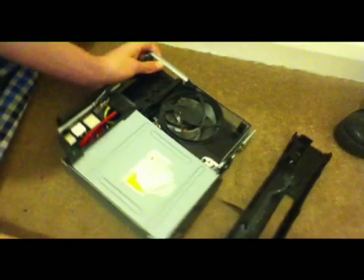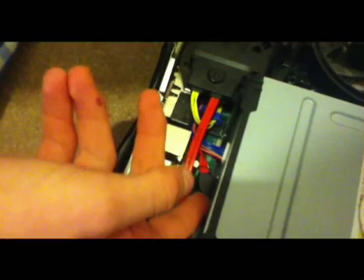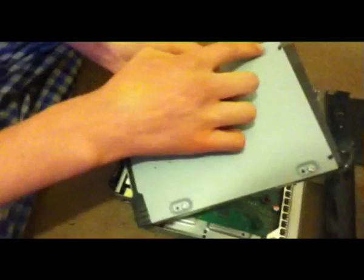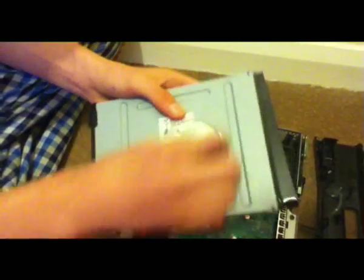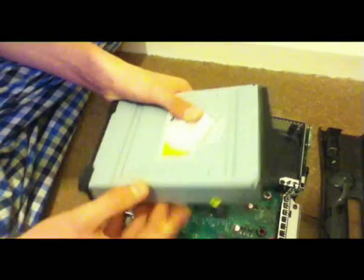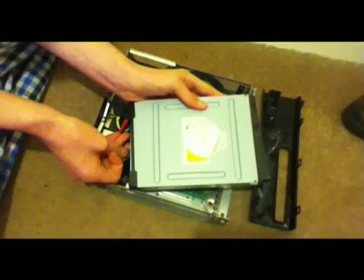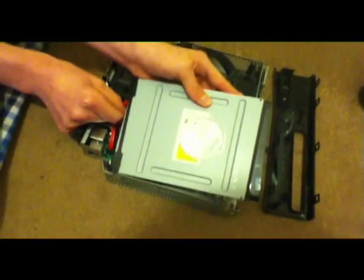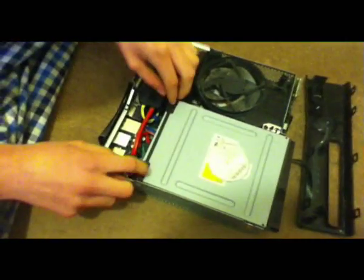This is the bit where you can repair. You'll see these two little wires in the back of this CD drive — basically you're going to take these out if you want to hot swap. You'll see there are four little screws; I'm not going to undo these because I'm not hot swapping, but you want to undo those screws and then it kind of slides out. Then you're going to want to scratch around this if it's your first time and pop that off — that'll get you through to the magnet. I'll make a hot swapping video separately. Once you've hot swapped, you've got to put these little cables back in — remember to put them in the right way or it's going to fry your CD drive if you put them in the wrong places when you turn the Xbox on. Also make sure you've got these rubber bits on when you go back to hot swap.